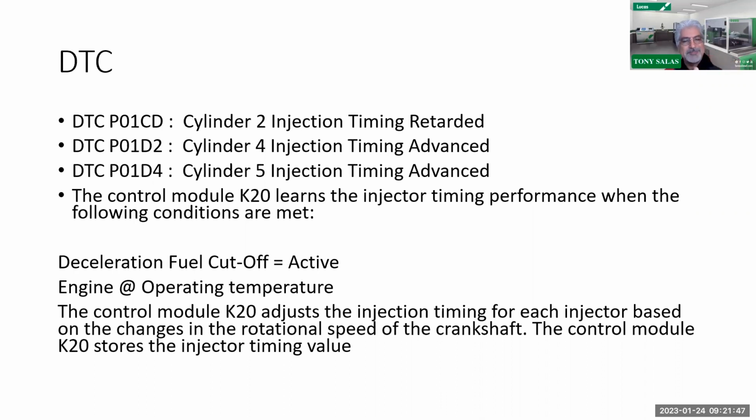So you know if it is failing, you can actually reset it. The reason why I tell you this is because don't forget, as much as these codes are here, computers can learn wrong. And you're like, what are you talking about, Tony? Well, is there a reset for injection? In other words, adaptive values, injector adaptive values. Yeah, you can reset it. So if everything runs great, I shouldn't be saying this, but I'm going to tell you anyway. If everything runs great and you still have these codes set, then the best thing to do, based on what I've seen already, is reset the fuel injector adaptive values on the scan tool. Then I'm going to get it all warmed up, go drive it, and go on a decel event. Using specific DTC, I'm going to type in those codes and see if that decel event performed the test, and it'll tell me if it ran the test, yes or no.